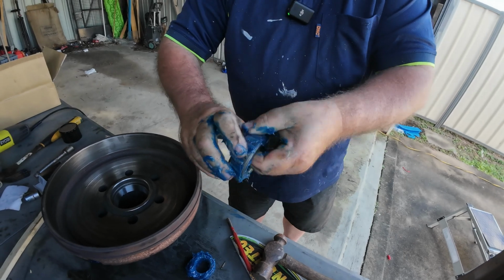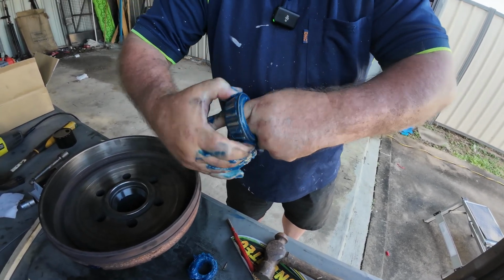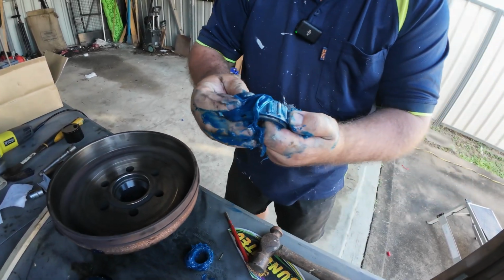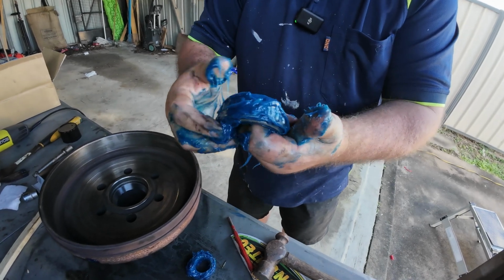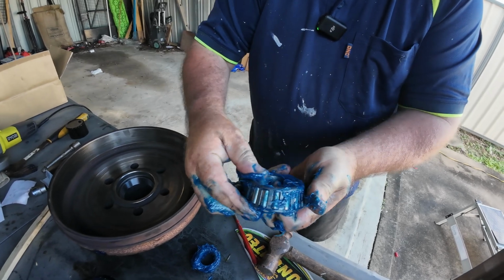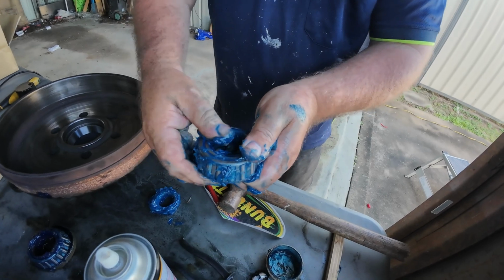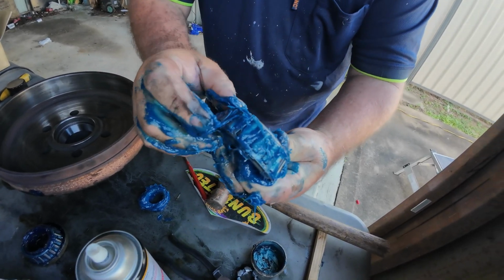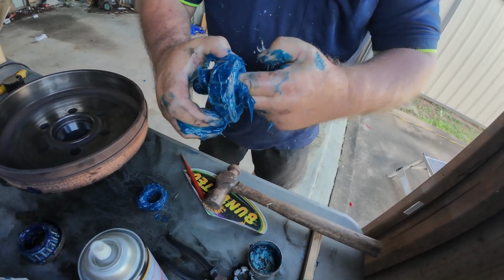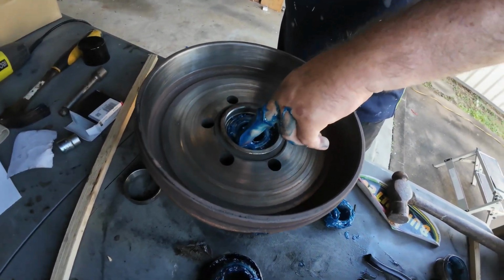That way, give your bearing a spin as well, to help get that grease circulated through the actual bearing cup. So we're applying some more on there. And you want to give it a good grease up, guys, to get that grease in there. Like so. See how I'm pushing the grease in, Phil, with me thumb? Yeah. And you'll see it'll be spurting on the outside of here soon. All right, so that's our bearing done. So we're going to drop our large bearing in now to our cup, like so.